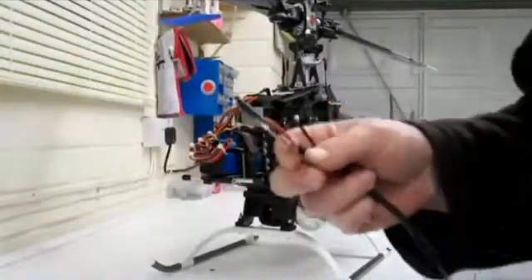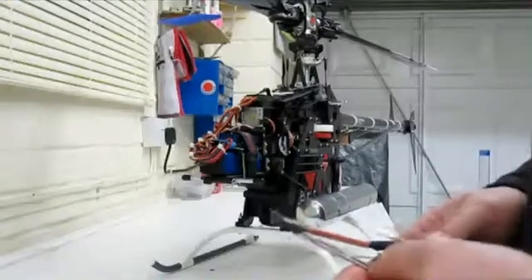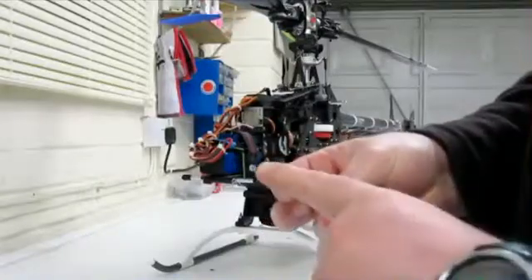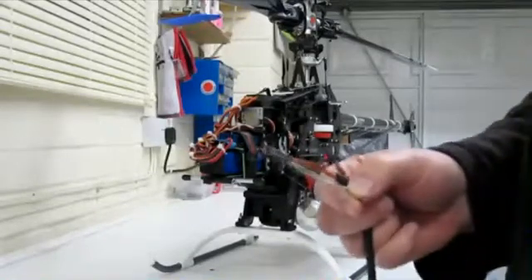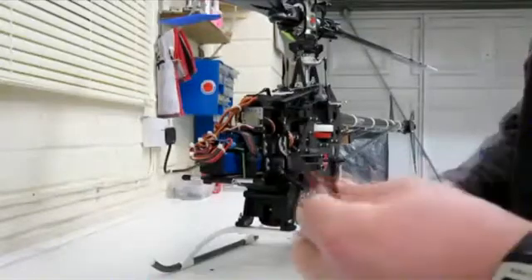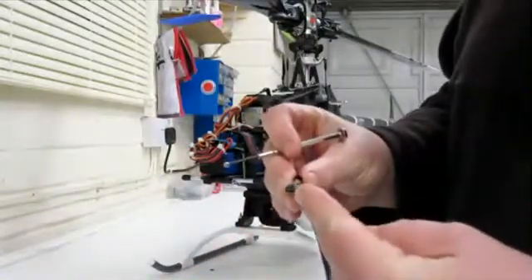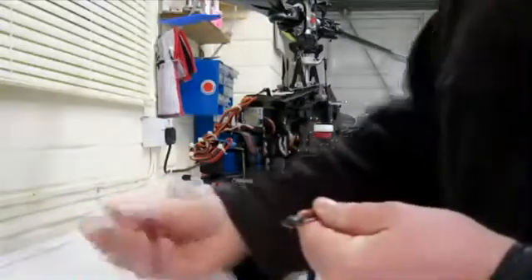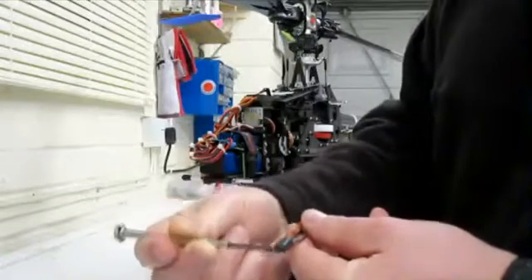The first stage I want to talk about is basically the magnet and sensor installation on the helicopter. Basically that's the sensor you get with the RevLock, just the end bit of the wire here. You've got a bracket here which allows you to mount it to the engine, and you get a magnet with it as well, as shown on the end of the screwdriver here. The sensor is particular to how the magnet has got to pass over and in what orientation. So I'm just going to demonstrate how it should pass over. If you look at the sensor here, you can see it's shaped like a D — a flat bit on the bottom and obviously the D shape. The magnet should always run over it in that direction.